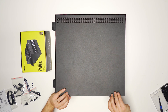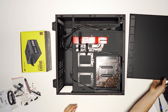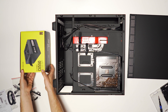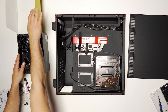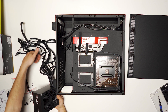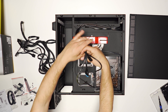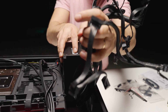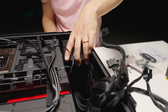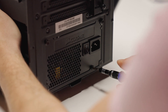Next we flipped the entire case over to work on the power supply. Take the back panel off, and for this build we went with the Corsair CV 550, which goes right in the bottom of the case. In this budget build we were not able to afford a modular-style power supply, so this one is going to have a bit of a mess of wires we'll need to hide away, but it will work just fine. Get the wires out of the way, install the power supply into the case, then flip everything upright so the screws line up and tighten it all down.